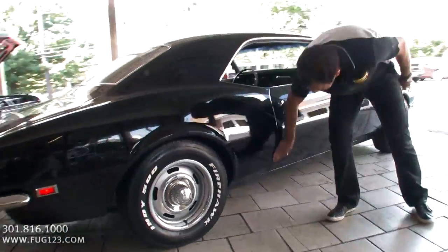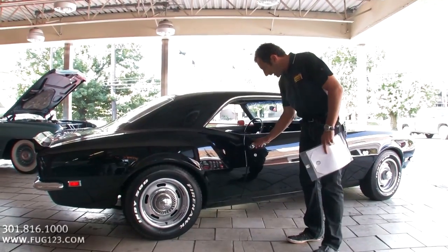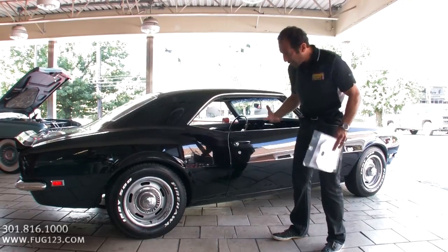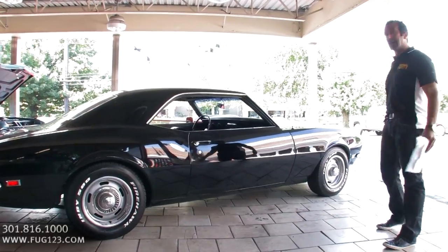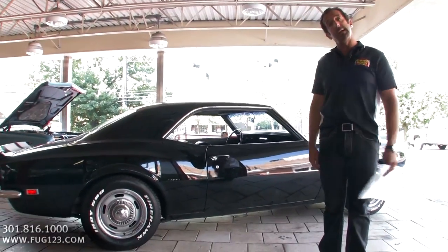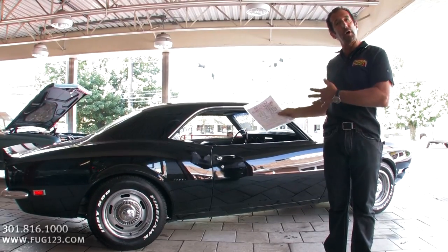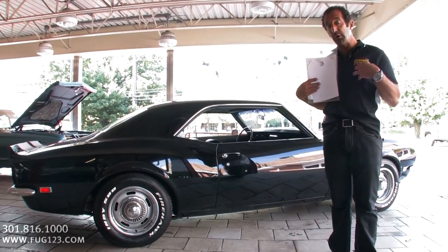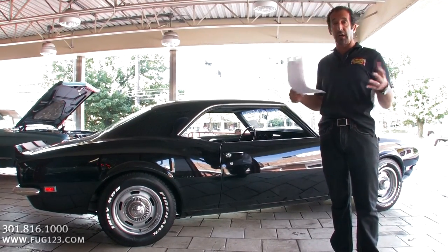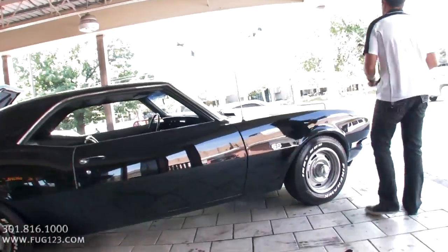That's why I wanted to take a second walking around the car so you could look at the fit and finish. A lot of Camaros don't fit down here properly because they're unibody cars — over time they sag. In this case here, the doors fit good; it opens and closes nicely, and those are some of the things you need to be looking for, especially if you're looking online. Get somebody to do a video for you. If this isn't the car for you, that's cool. Make sure you do the video because the video shows all the ugliness if there is any — pictures can hide so many things.